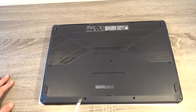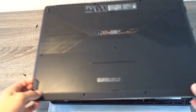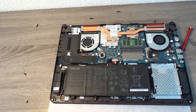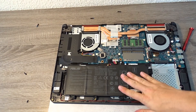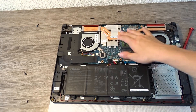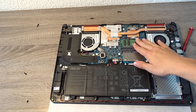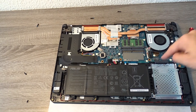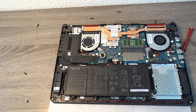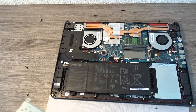Taking a look inside the laptop, you need to unscrew 11 Phillips head screws, then unclip a few clips. Inside you have one HDD bay, two fans with heatpipes for the GPU and CPU, a 55Wh battery, and one expansion RAM slot — it has 16GB preinstalled. I will upgrade the laptop with a 500GB HDD, and later on with a 1TB Western Digital Green SSD.